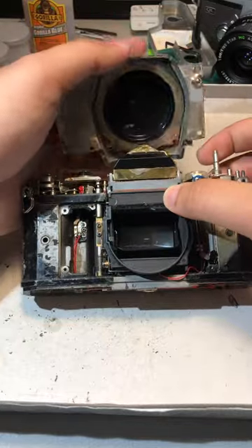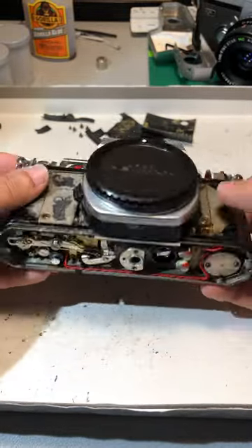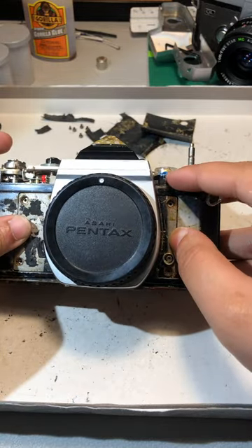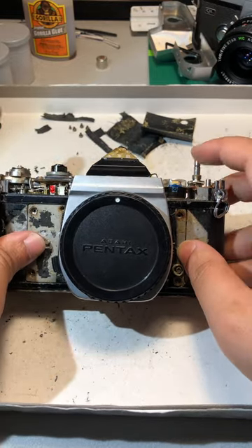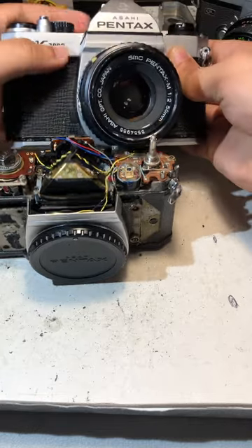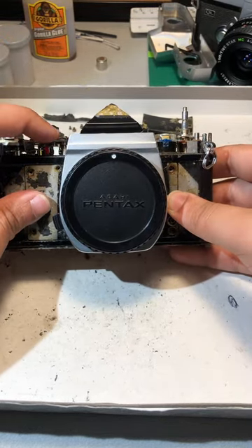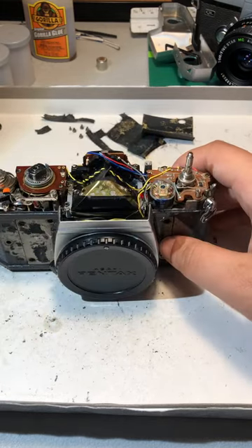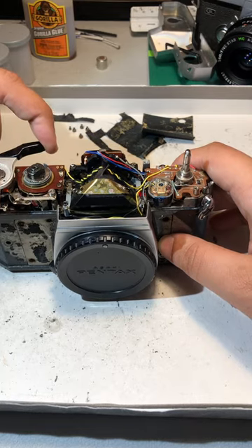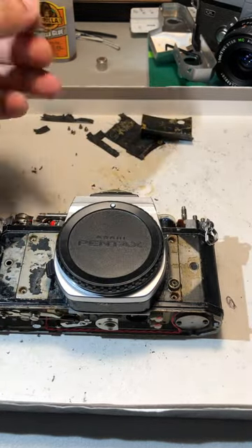You can hardly see it, but yeah. The camera — I have no clue how to get it working. I'm sure I could figure something out but I don't know if it's worth totally destroying the camera for it. I think I'll just keep it for parts. This piece right here is cracked, and it will move up and down. The shutter has been fired, but you can't fire it again until you wind, which re-cocks the camera. I think the issue is the shutter has been fired so it won't go again, but if I grab the wind lever and stick it on here, I can't wind it — it is totally locked. I can push as hard as I want but it just won't budge. So it's best kept as a parts camera.